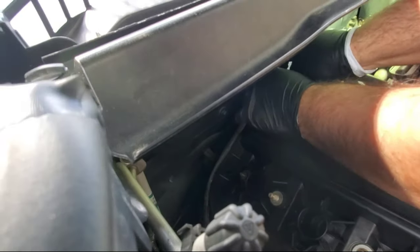Once that last piece is out, wash the entire valve cover with degreaser and water, scrubbing with a brush. After cleaning, take 'The Right Stuff' 90-minute gasket maker and put a small bead of it in the groove where the gasket sits in the valve cover. Just a little bead all the way around — this helps keep the gasket from coming up and falling out.